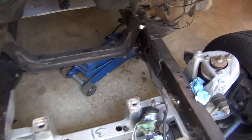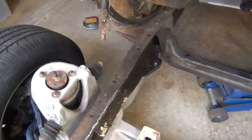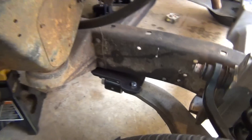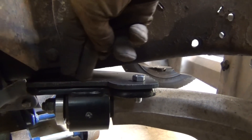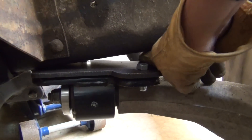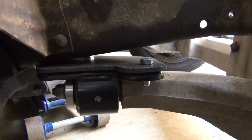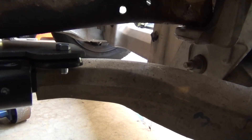So I'm not going to stay this way. I'm going to take a little bit of time and put the brackets back. This was just a demonstration to show you guys online that you can do this if you want to. You're still going to have to put some reinforcement plates on this regardless — on the 67 through 72 frame, you're going to have to come along here with some plating and drop it in here inside the head of the screw and fill that gap, maybe something across the front too. The frame is just right on those little bosses where the screws come through.